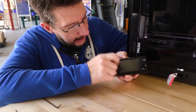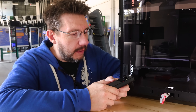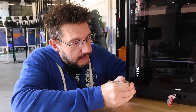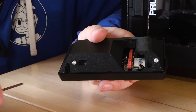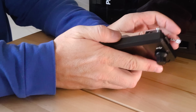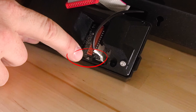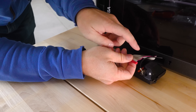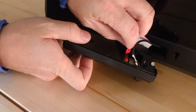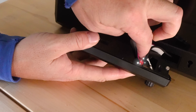Next steps are the LCD. This is it — you can tell because it always tells you how to get home. There are connectors on the back that these wires go into, and then these two screws are what hold it on to the frame. To install the LCD, the first step is to loosen these screws just a bit — not all the way out, just enough to slide over the metal of the frame. Then next is attaching these bits. I've got big, meaty fingers and I can still do it, so if I can do it, you can do it. This arrow indicates where pin one goes, and that red part of the cable is pin one, so those match up. That little piece sticks out and goes in this slot, and if the stars have aligned, it works.